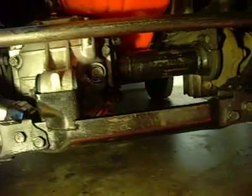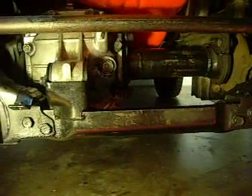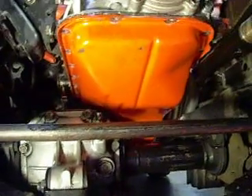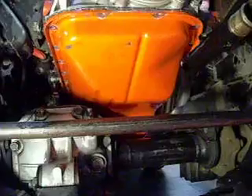It's saying to remove the crossmember, drop the linkage, and lower the diff by an inch or so — something like that, I think it said. It did not say to drop it down as far as it'll go or remove the bolts — it just said to loosen them so that you can drop it down enough to get the pan out. It said nothing about the oil pickup tube, which I find strange.